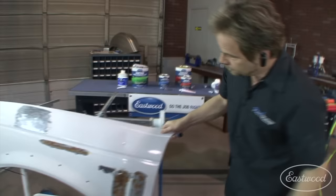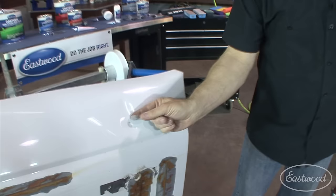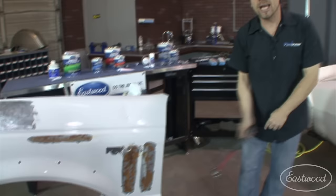In the mid-50s, fiberglass or polyester fillers — which is basically plastic — took the place of lead and kind of took the industry over. Bondo, which is a brand name polyester filler, got a bad name and it hasn't really shaken it. But you can do this — it's a lifetime repair if you do it properly. If you abuse it, you can have a failed filler. For instance, if you grind that down and fill it in, you can have a half inch of body filler there — not good. That's not how to use body filler.